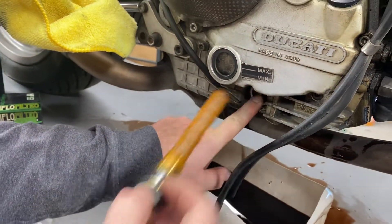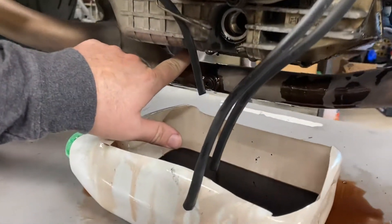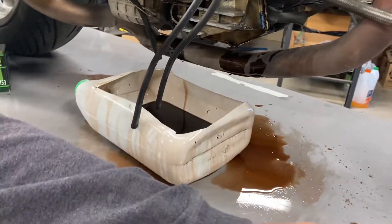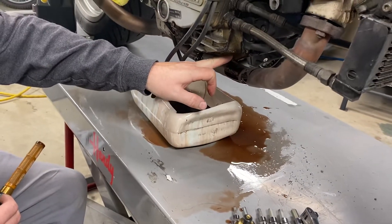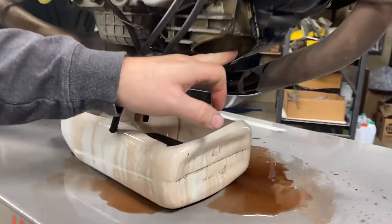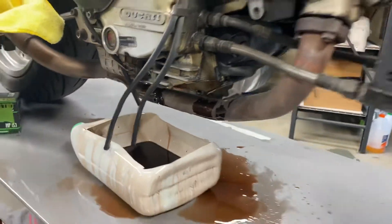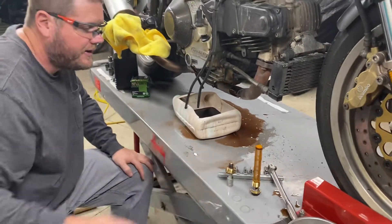Make sure you loosen that after you loosen up your drain plug, which is under here — it's a 10mm Allen. Then you need either a 17mm wrench if you have a K&N, or a standard oil filter wrench to remove your oil filter. There are actually three things you need to remove to change the oil in these.